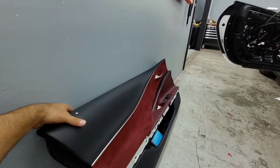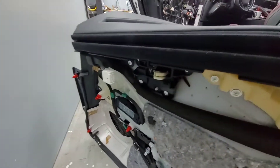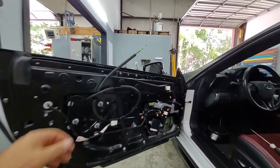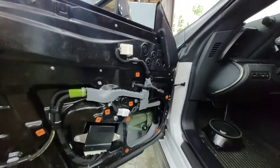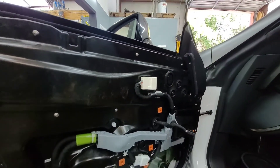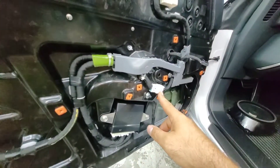The door panel is off — it was just those two screws. You're gonna unplug that little plug there and then pop a cable off your door handle, which is this little green guy here — that's your plug for your door panel. Your mirror is bolted in through — you gotta pop these caps off, it's a 10mm bolt. With the window rolled down this way you can access everything. You'll take those off and unplug this, which is your plug for your mirror.